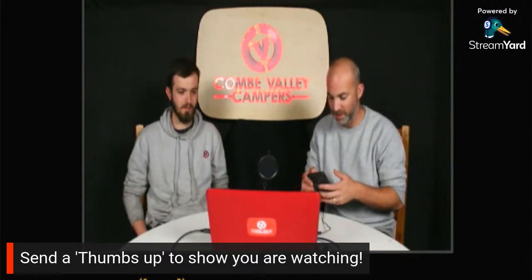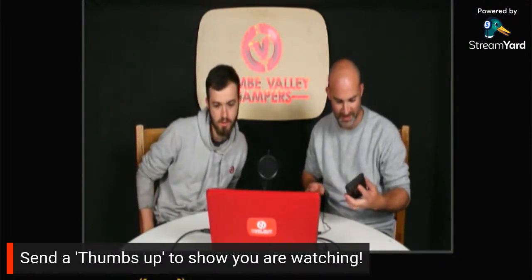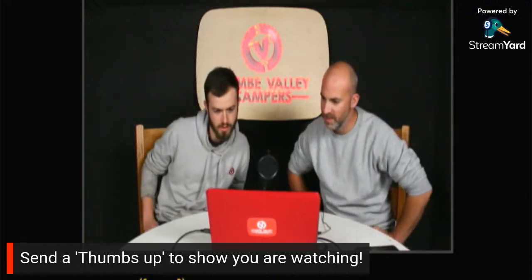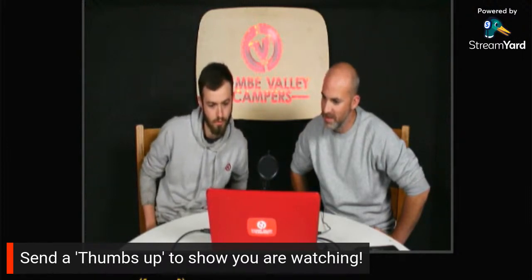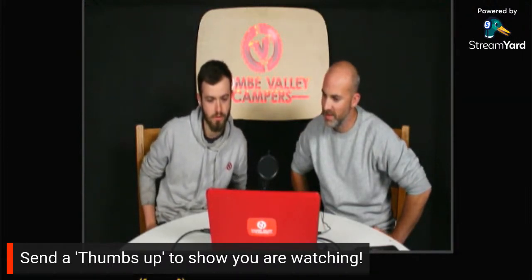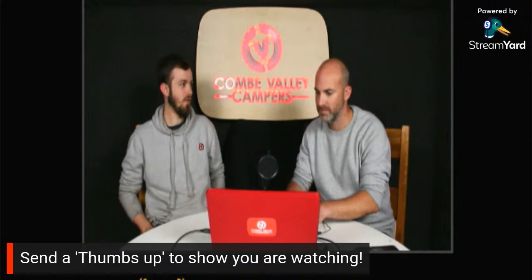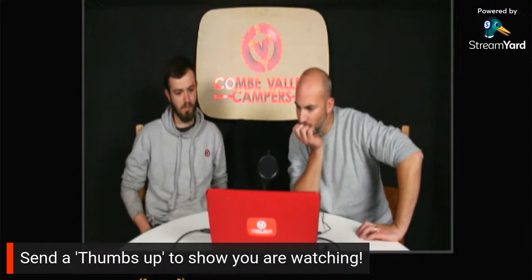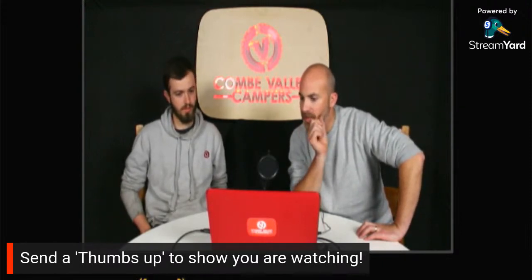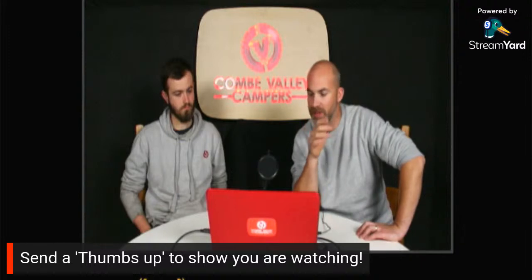I'm just checking if this is a question in on my phone. So yes, we are going to go with our next. We've got Ewan Dunbar who has said, can the Dodo Mat Super liner be used on top of Dodo sound deadening for sides and roof and barn doors, or do I need to use the reflective insulation? I see. So the Super liner is what we used to use on the floor before Dead Mat Duo came out, didn't we? Yes. It's the non-reflective product. Can it be used on the sides? So yes, it can. Yeah, Ewan, the Super liner can be used on top of the sound deadening for roof and barn doors. No, it's fine. Absolutely. You go ahead.